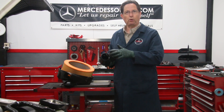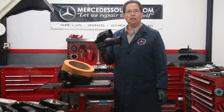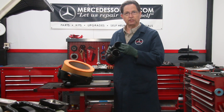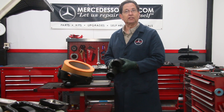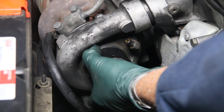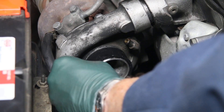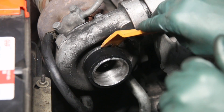This is a very poor design — this lip right here. I have a video on my website showing how to modify this intake elbow so that when you take the air filter housing on and off and clamp it down, you are not going to push this top seal back. We have brand new seals on our website. Now let me show you the lower seal — the one that clamps onto the compressor housing inlet. Most of the time this seal will come right off when you pull the intake elbow off, but this one is frozen, literally stuck. It's so hard you can't even indent it with a fingernail, so I'm going to have to take a pry tool and slide it off.